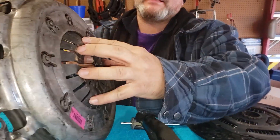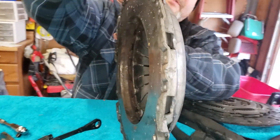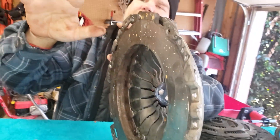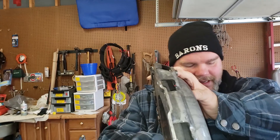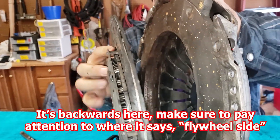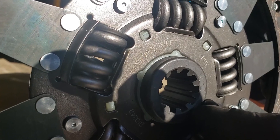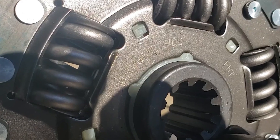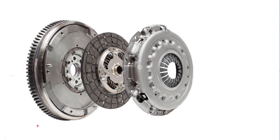It's going to release — it's going to push these springs down, and on the opposite side of these springs, there's the other end of the springs. They're going to go like this — it inverts them, so that they're not making contact with the clutch plate. You release your clutch back out and these come back out to normal.